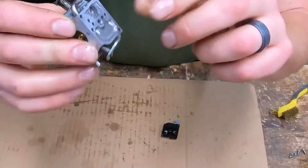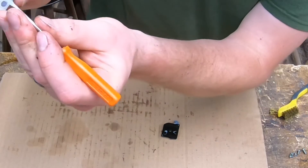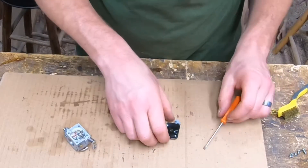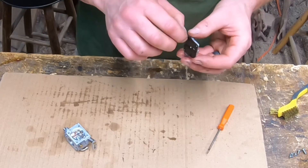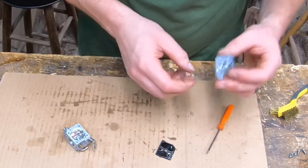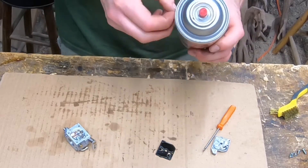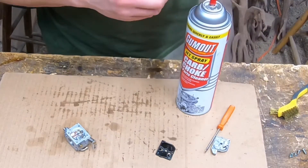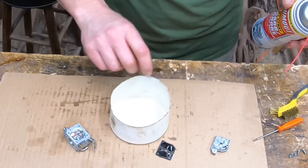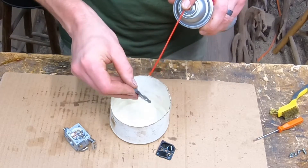There is a filter — a little screen — and mine looks really clean, actually really good with nothing in it. There is, though, a bunch of sawdust right inside the carb. This could have been from blowing it off with air, or this could be part of my issue — sawdust got in there and it's making everything run bad, or there's a major underlying issue with the saw. There's also debris on this little screen. Having a new can of carb choke cleaner with the little hose attachment makes cleaning parts much easier — pop that in the nozzle and blow everything out.